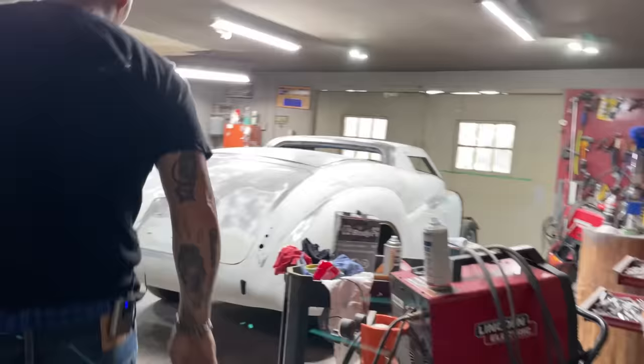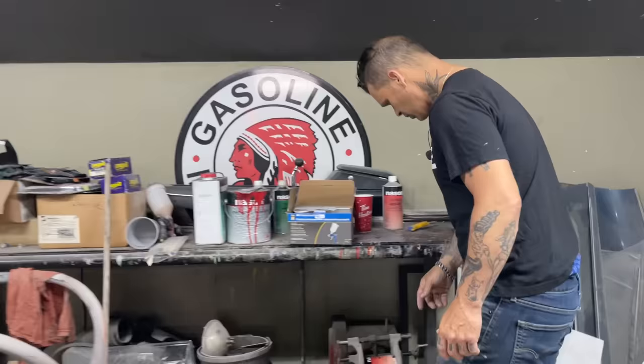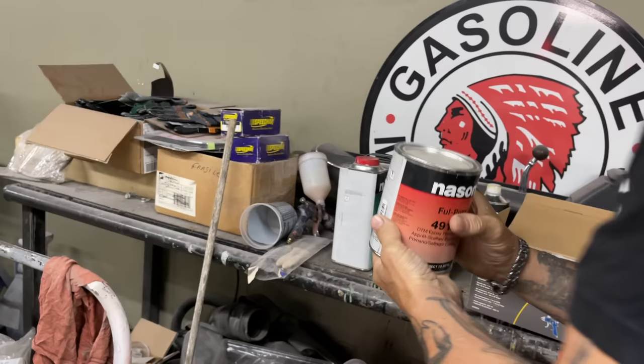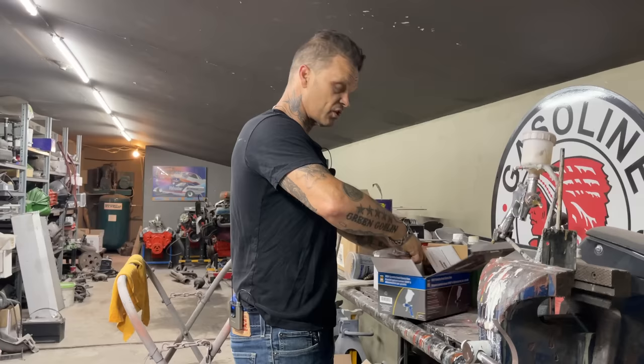So when your car is many different colors, before you paint your car, and this is just a suggestion, you do as you please, but I would try to make it all one color. And how I'm going to make it all one color is I'm going to put a coat of epoxy sealer on it. This is called epoxy primer sealer. I'm using it before I put the paint on, to make it all one color. It's going to seal the red and the gray and give me one playing field to put a coat of paint on. Also, if you've ever seen a coat of paint that you can see through, or you can see different colors in it, or darkness or lightness,